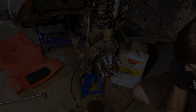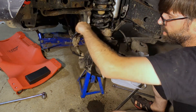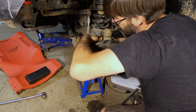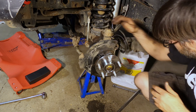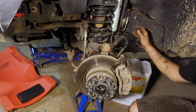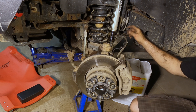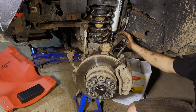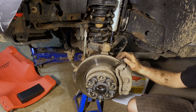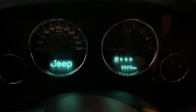Now it's the question of feeding the ABS sensor back the way it was - I'll route it fully once the caliper is reinstalled. I rerouted the line; the important thing is after where it attaches to the shock, I routed the wire in the back and reconnected it, then came back and reconnected this end. The driver's side wheel bearing is now changed, including the ABS sensor - let's see what the computer tells us.